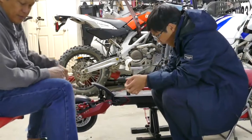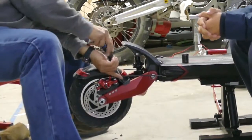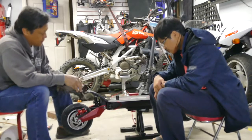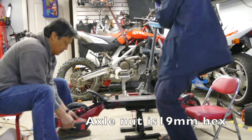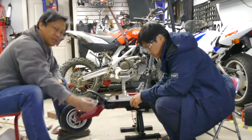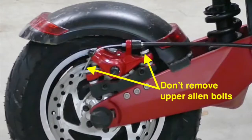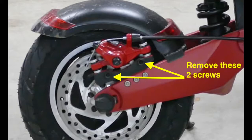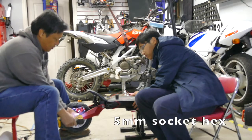We're going to tackle the shock removal. I think we'll move the rear fender first. We'll take out just one side. Next we remove the axle nut — that is a number 19. There is a key washer in there. Now we'll remove the disc brake also. These are cable brakes. I don't want to remove the Allen screw because if I do, I'll have to readjust the brakes, so hopefully doing it this way I won't need to. This is a five millimeter Allen screw pivot shaft, 19 millimeters.